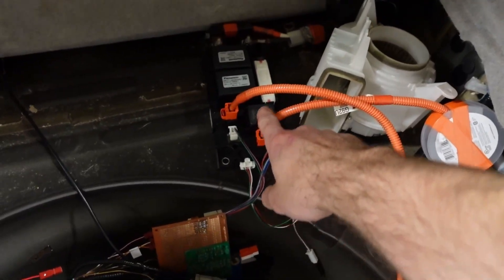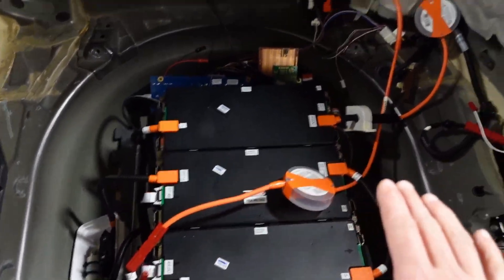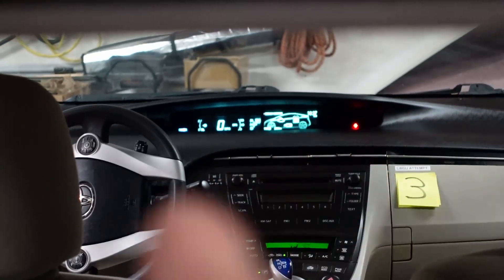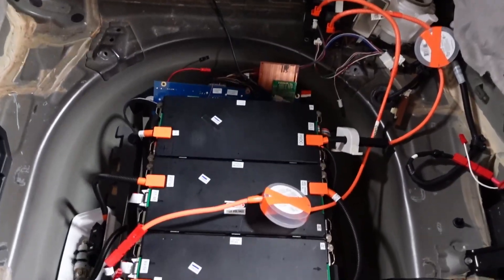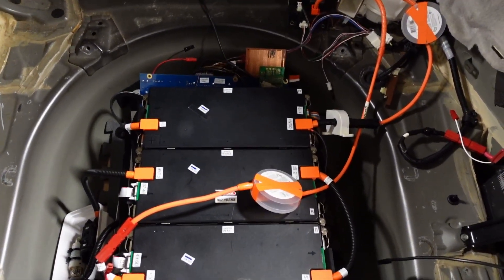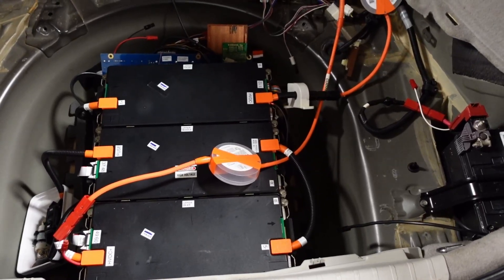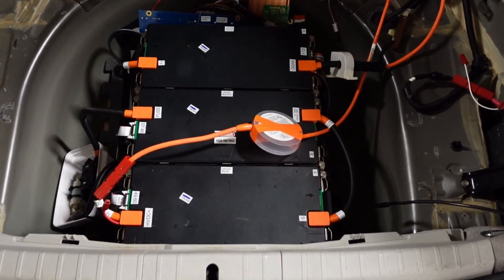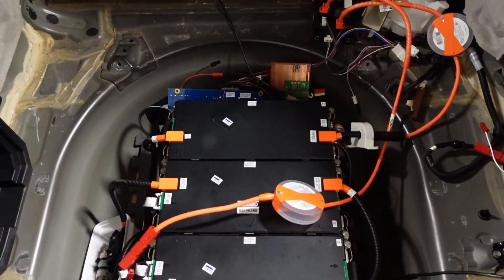We have the pre-charge and charge contactor, the pre-charge resistor, and the fan - all that stuff remains OEM. Just replacing the BSU. This will be replaced with a pack that goes where the original pack goes in the car, so it won't be in the wheel well. You can see the car is in fact in READY in the bottom left corner. We are using our own firmware instead of the BSU, which means we have complete control over pack current, voltage, temperature, and HVDC isolation - all the things the BSU does - so we can do it safely with complete supervisory control.